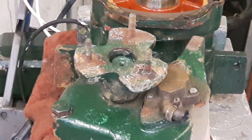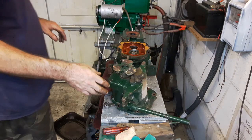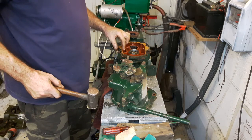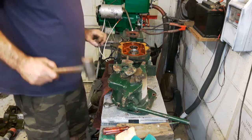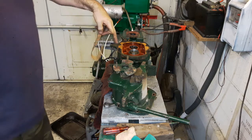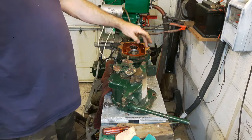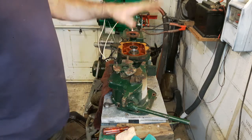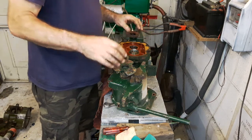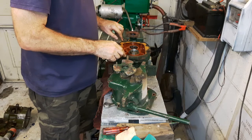That is the procedure for shimming up the gearbox in general, and this is how you take it apart. When you put it back together, you're literally mashing it back together on these dowels. Make sure that the gasket isn't crimped — it's cleanly over the dowels. I've got some new gaskets here. You'll get these — they look like this — and drop them over the two obvious dowels. Check that the dowels have gone through the appropriate holes on the gasket and it's not going to damage it.